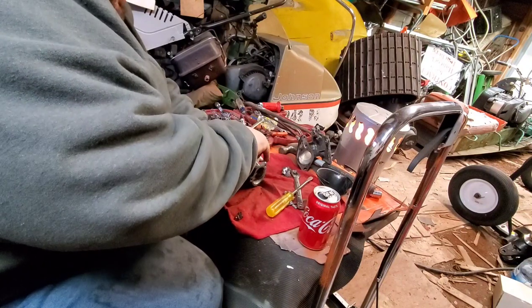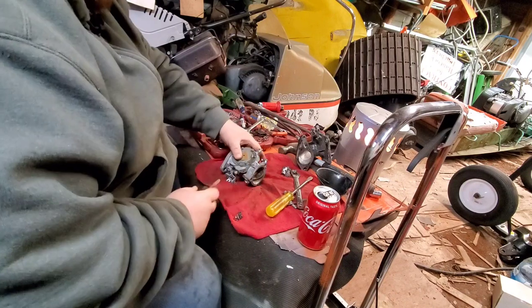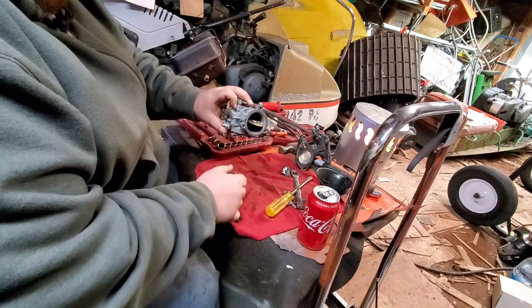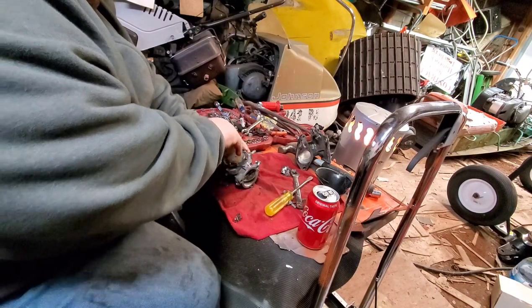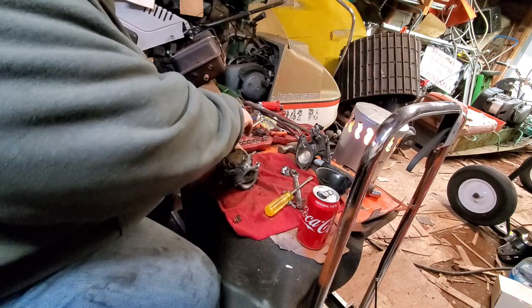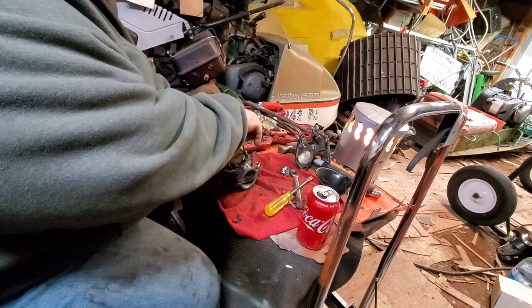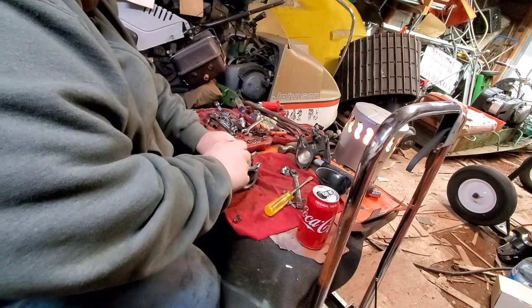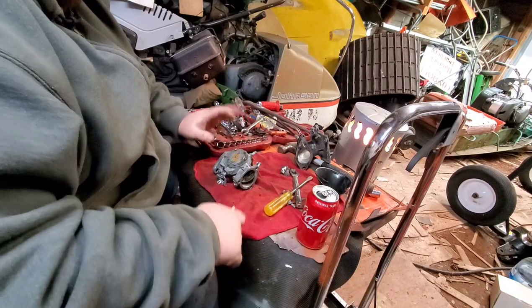The beautiful thing about these OMC Tillotson carburetors is that normal Tillotson carburetors have a fuel pump down below. And when I say normal, I mean like the early Polaris, the 1970 Charger, the 1970 Skidoos, Olympics, anything that has a Tillotson. They've got that fuel pump here on the bottom, and it's just extra diaphragms that pulsate with the engine vacuum.